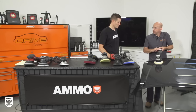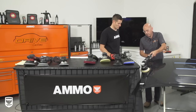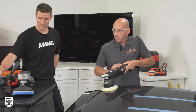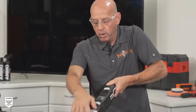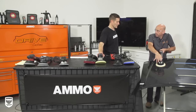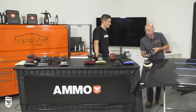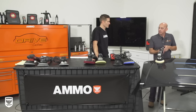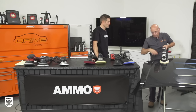With the gear-driven machine you can still do it one-handed — where you couldn't on the rotary that easily. It wobbles a tiny bit but remains very safe. And unlike the random orbital, it will never stall — it stays constant. That constant torque and drive means it powers right through resistance. The reason it doesn't grab and tear into the paint is because it's constantly shifting the pad direction. The rotary is focused in one direction and digs in when you push down; this one can't dig in because it's being moved around all the time.